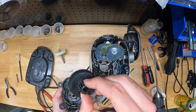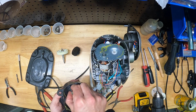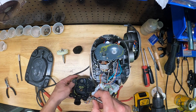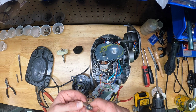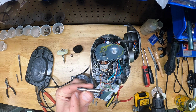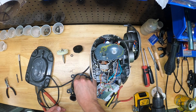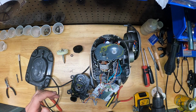And so I've slid out the main drive shaft with the slipper clutch gear. There goes our black replacement gear, and then there's a little shaft that pulls out of this thing, like a jack shaft, and there's a spacer on this one. Again, if you buy my gear off of Etsy, to make it easier to 3D print, I've split the replacement gear into gear and then a spacer, whereas the factory Breville gear has the spacer kind of molded in, but same thing, just 2 pieces.